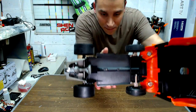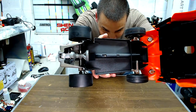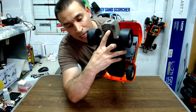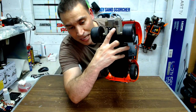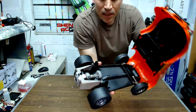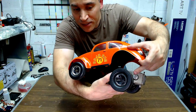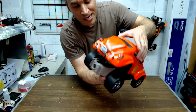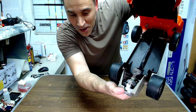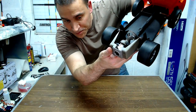They open up. You see the little motor with the pull start? And you engage the gear with this. This one does have it. It has a lever here that switches the gear onto the motor worm gear there. See it? It also has a glow plug. You hook the battery on right there. And when you have it running, you adjust the needle valve like the new gas cars. But this only has a high-end needle valve.